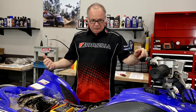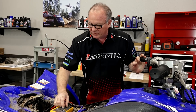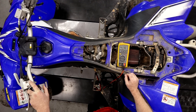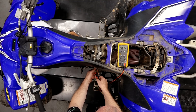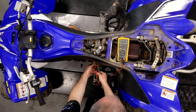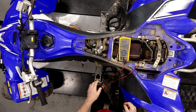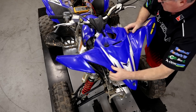Like I said, I'm not a huge fan of doing just a resistance check because it's really not that accurate. The test I like to do is take your meter, put it over to AC, and do a measurement directly across the windings, measuring AC voltage. It should be in the 35–40 volt range. That verifies it — our stator's in good shape. So what I want to do next is pull this front panel and take a look at the regulator rectifier and see what's going on with it.